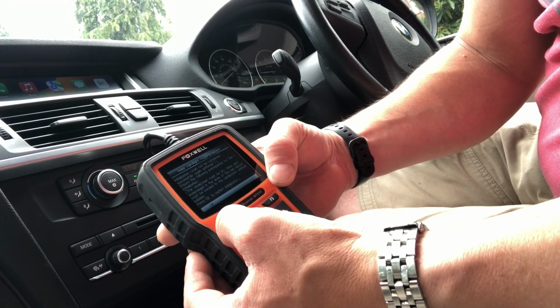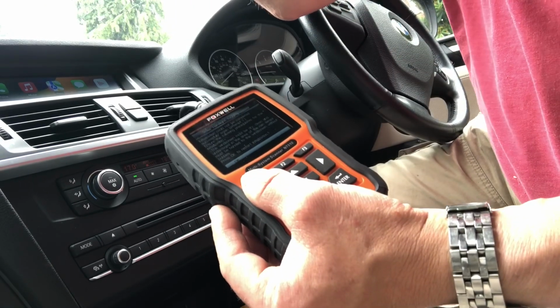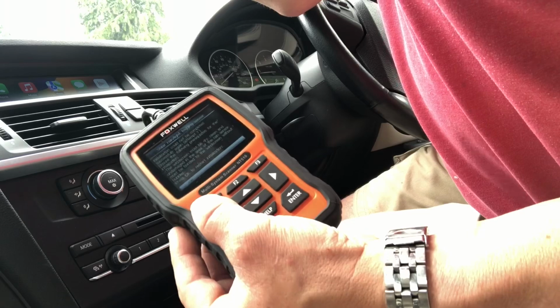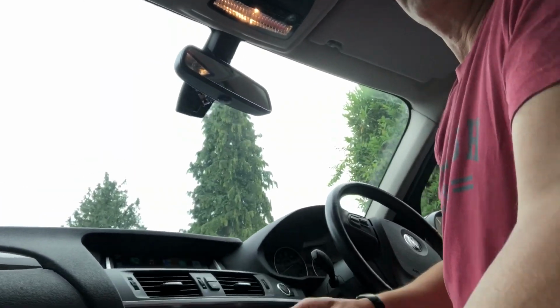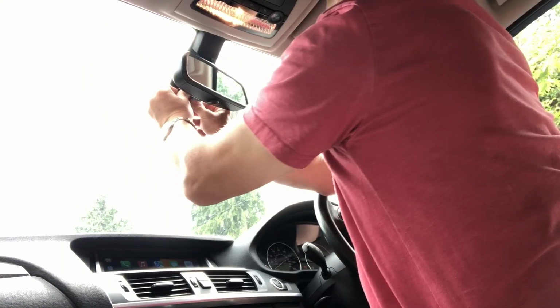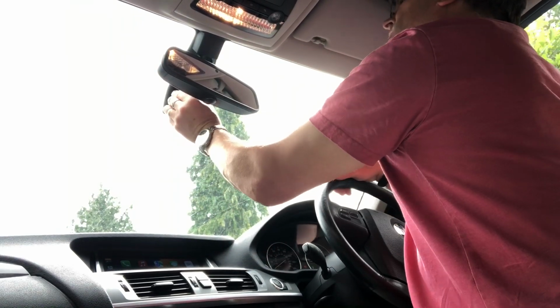Initialization could not be completed successfully. Again, attempt 1. Ensure the following prerequisites. Windscreen must be dry. Okay. Perhaps there's a bonding issue with it. One that says release the clamps and give it a shove. Let's see if I can release the clamp and give it a shove. I need a tool to get under there, really. But definitely on the windscreen.